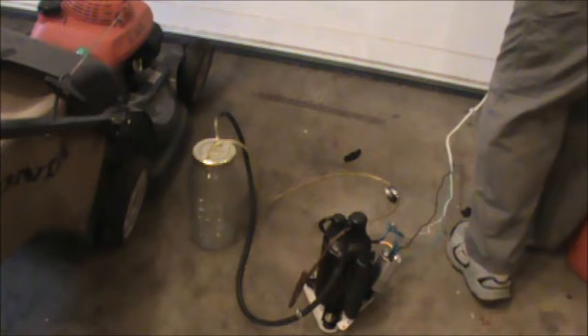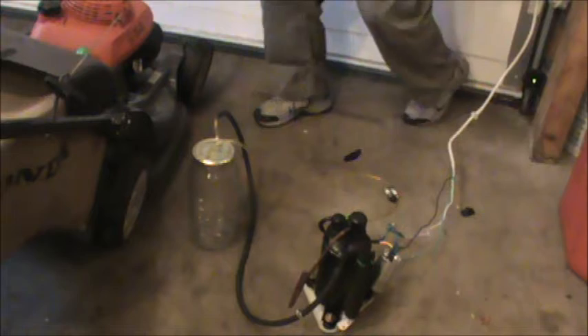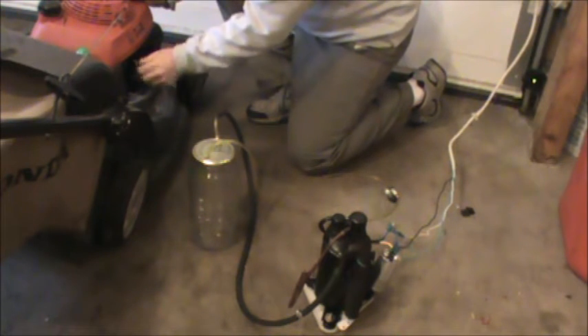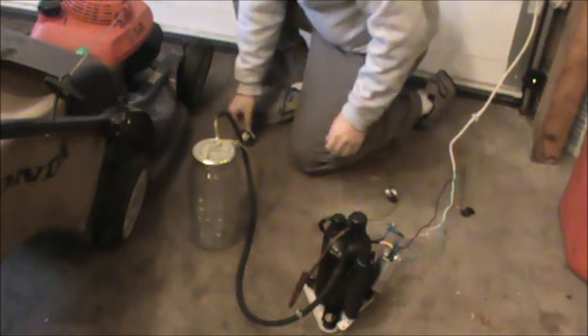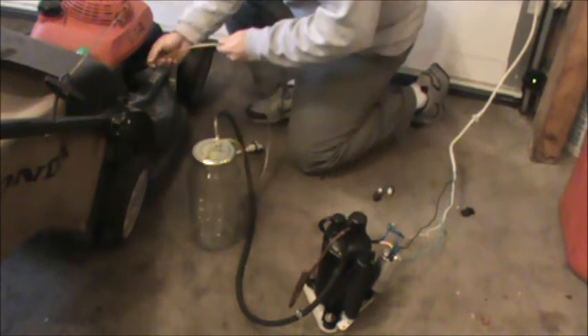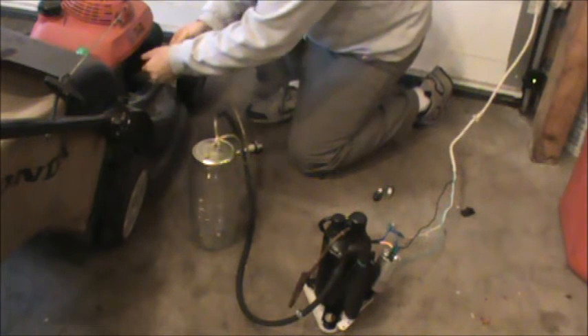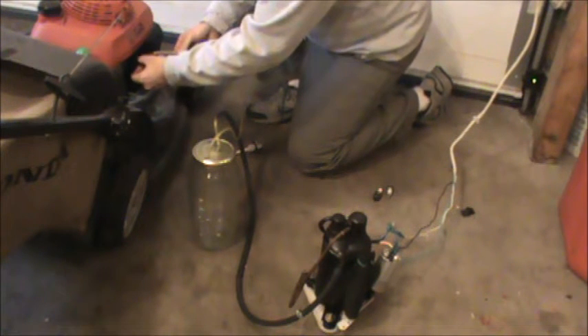This should pull out about half a quart. I'll pull the dipstick — I already heated up the engine for about three minutes — and we should just be able to feed this hose down in there. If everything's working, we should be able to draw oil.